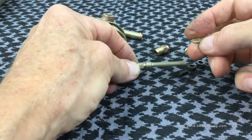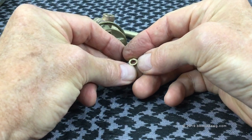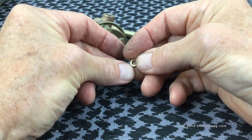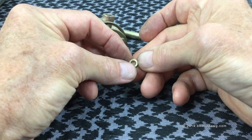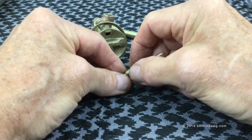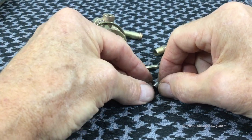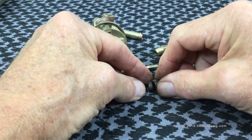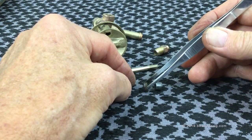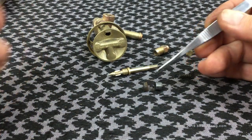Here's that little ring — remember, one side of it is dished, and the other side is flat. The flat side is going to go towards the gear teeth on the spindle. You can see these two graphites: the one on the left is the original and it's less than half the size of the brand new graphite on the right, so the old one is pretty much gone and I'm going to replace it with the new one.